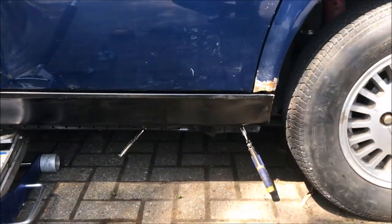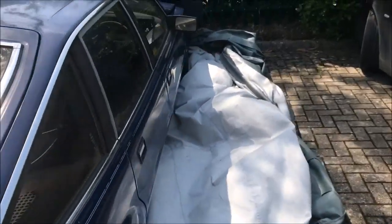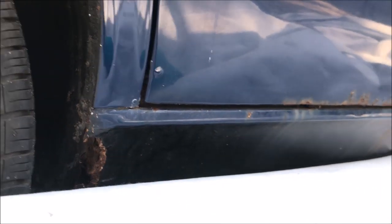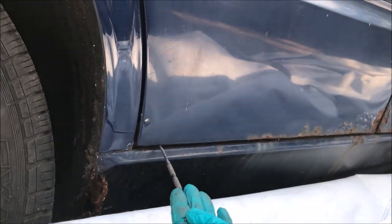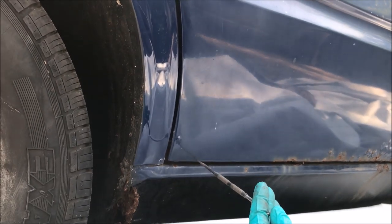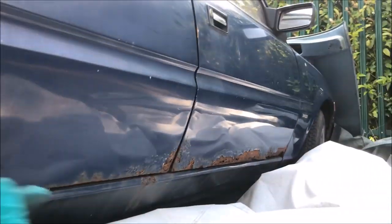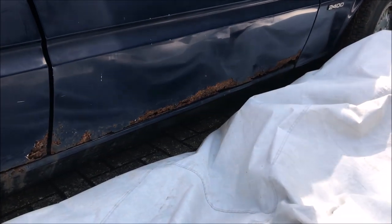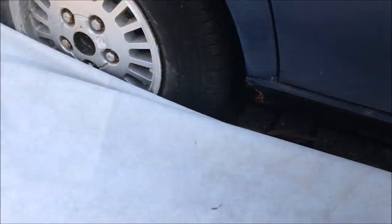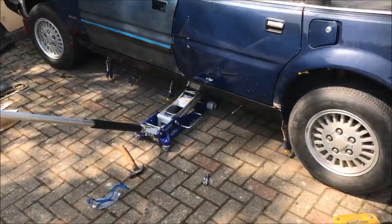It's looking a lot better now I've kicked that rear end up. Looking on the other side of the car — these are old cars, so they were never made with tiny tolerances. The gap is slightly smaller than I've got on the other side. I'm going to get a steel rule and measure what that gap is at the top and the bottom, then try to get the other side of the car to look somewhere similar. If the sill is opened up, I'll have to take it back off and manually close it up, which means just standing on it. We shall see how close we can get just using the clamps and my right foot.